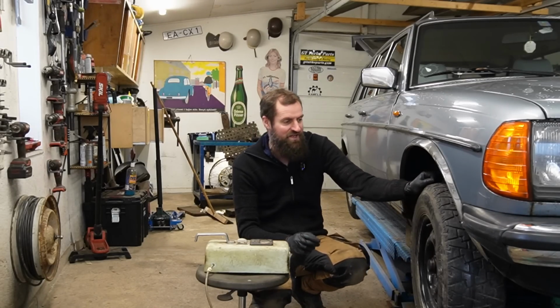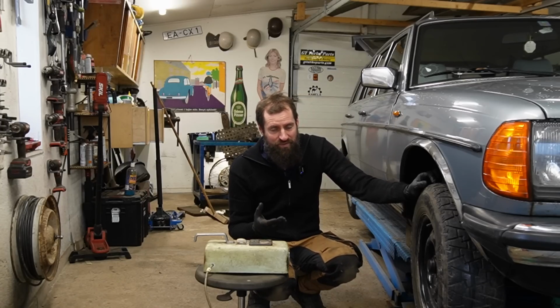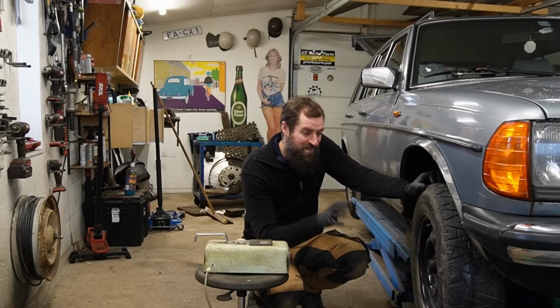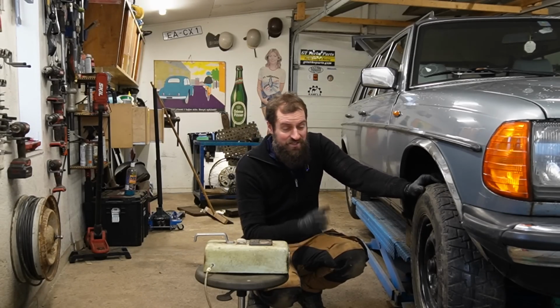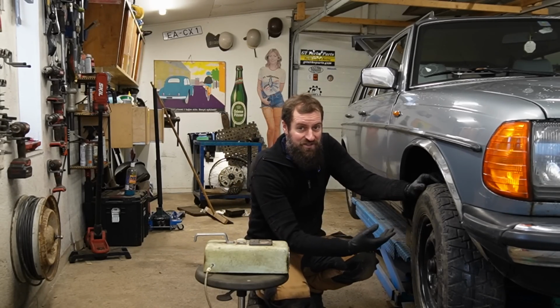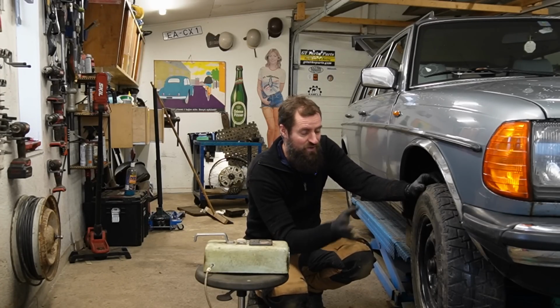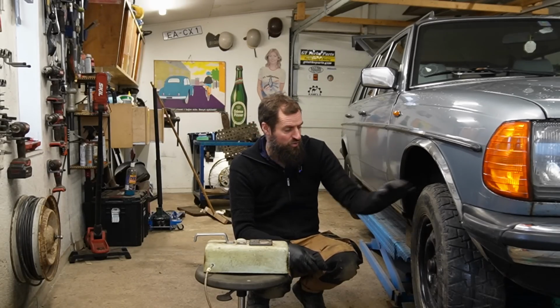I don't think it's a machine that I'm going to use very often, because normally a completely normal balancing job will do the job. But at high speed, sometimes this machine is what's needed to fix it. The thing with this machine though, is that you balance the entire axle, so you will have to put the wheel on in the same position. If you take it off, you can't switch them around or so on. If you do that, you will have to start all over again.